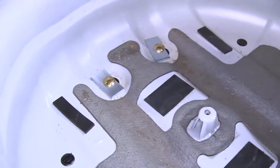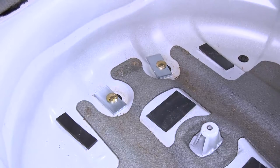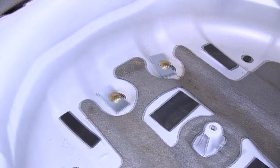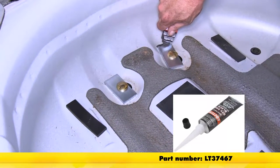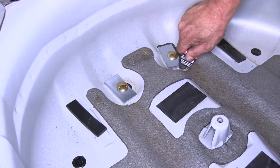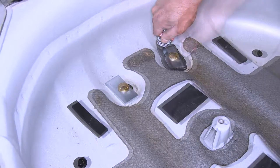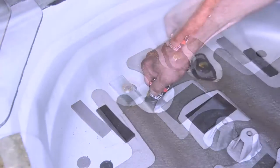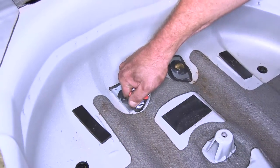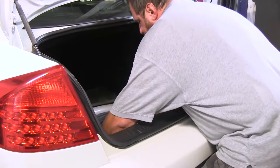Our last step on the inside of the trunk is to put a little bit of silicone around everything to seal out any exhaust gas or water that might get up inside the vehicle. If you don't have any silicone, you can pick it up on our website, part number LT-37467. We're going to put a nice generous bead all the way around the outside and around the top of the bolt as well — we'll do that for both sides. We'll let that dry for a bit and then put our tire and all of our carpets back in.